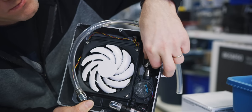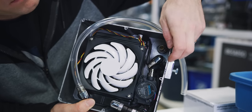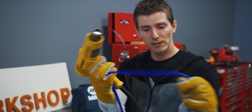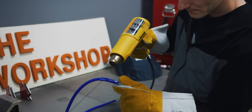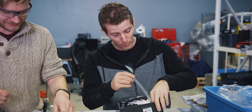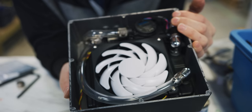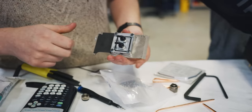This is going to be a really tight fit — I can't get a tube in there. Like this hole should be even a quarter inch that way and I'd be able to get it in there. These silicone hoses are normally used for bending hard line tubing, but fun fact, you can actually use them to bend soft tubing as well. This is going to work way better than I could have possibly hoped. Zero kinkage.